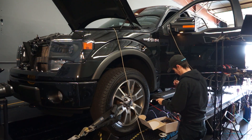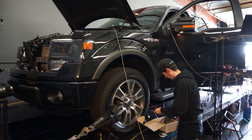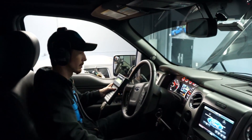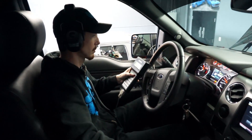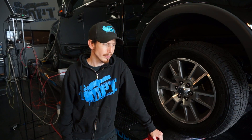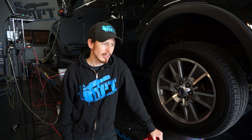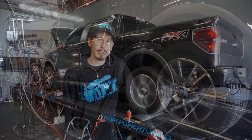Part of our calibration process is to connect our aftermarket knock sensor to the engine. These trucks come with a very reliable knock sensor, but there truly is no comparison to strapping on some headphones and listening to the engine run while we perform these dyno tests. We also connect our aftermarket wideband sensor to check the air-fuel and make sure everything is good to go. And then lastly, we strap it down to our Dynacomp 15,000 load bearing control dyno.